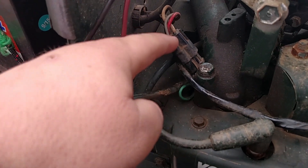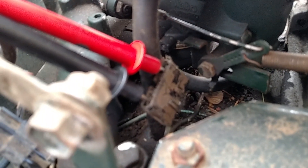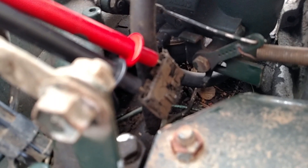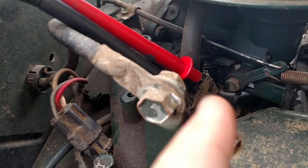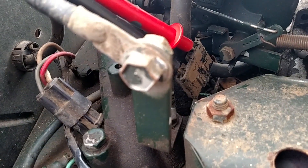You don't actually test the wires here. This is the plug where I have my leads into from my meter. There are three wires that go to the regulator. The outer two are the wires that come directly from the stator. The center one is from the battery itself — that gets regular battery voltage. So whatever your battery is, if you were to have it hooked up and measure that center wire in here, you would find that was your battery voltage.